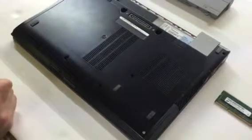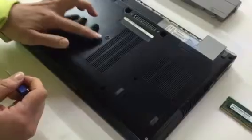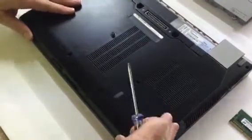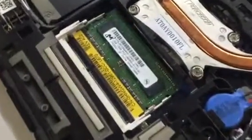This design is a very easy design to get at the memory. There is one screw, located right in the center of the bottom of the laptop. Take that screw off, remove the cover, and you'll note there is a slot where the memory is.